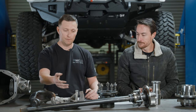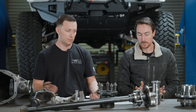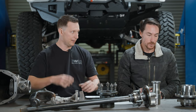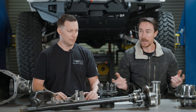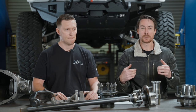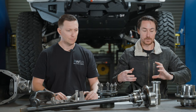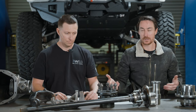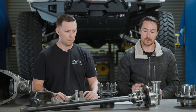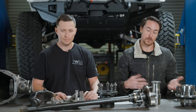It's also worth bringing up unit bearings — we consider that to be a full-float, a live-spindle full-float, because the center section is turning but the outside is stationary. On all of our stuff, you have a lower shaft — it's a double-splined short shaft, 35-spline inner and 35-spline outer. That is your final drive on the portal, and on every bolt-on application it's 35 spline. Our race stuff is different because those guys run huge horsepower, but on all the bolt-on applications, you're going to be 35 spline on final drive.